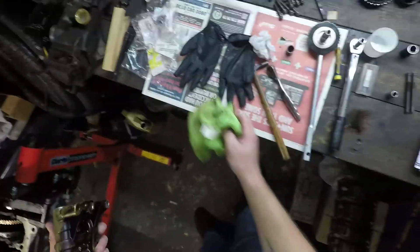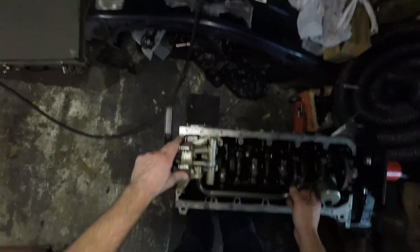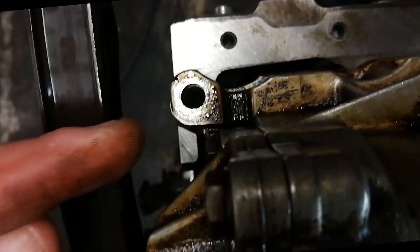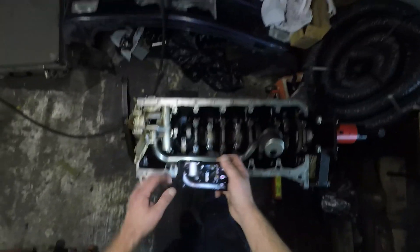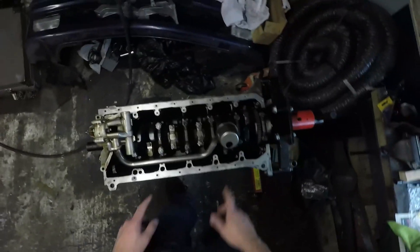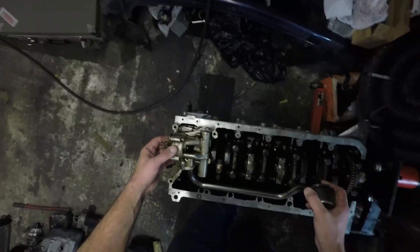I've got to take this bracket off the old baffle and weld it onto the new baffle plate when it arrives - that should be here in a couple of days. I'm using the M52 oil pump, which is amazing for how much oil it continually keeps weeping out. The M52 oil pump doesn't quite fit perfectly - this bolt hole lines up perfectly, as does the front one, but the one at the back is offset. What I'm going to do - as I've seen others do online - is open this out a little bit to 10 millimeters to get a bolt down into that hole. We're a week down the line but we're getting somewhere.